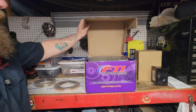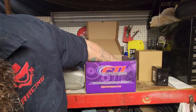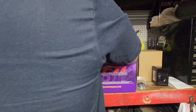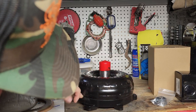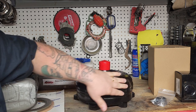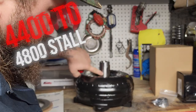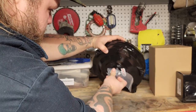The big deal is we got our torque converter back from FTI. We got our extension that goes on the back side of the torque converter into the crank, and our torque converter looks awesome. They cut this unit open — this is a billet part down here, welded on. They fixed everything that needed fixing, restalled it, and it should roughly raise the effective stall by about 800 RPM, which is a lot because it was a 3,600 stall, so now it's like a 4,200-4,300. It's got a brand new hub on it, everything's looking great.